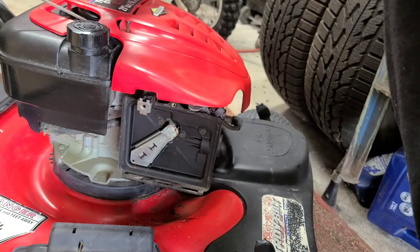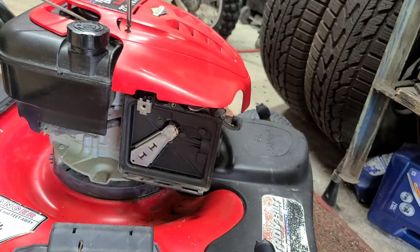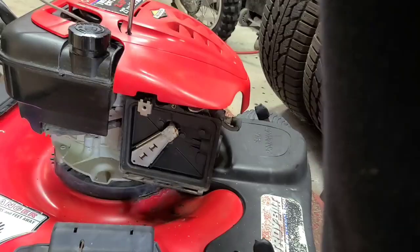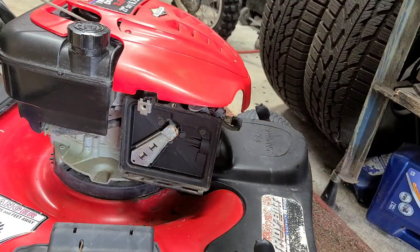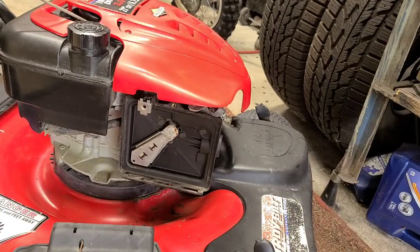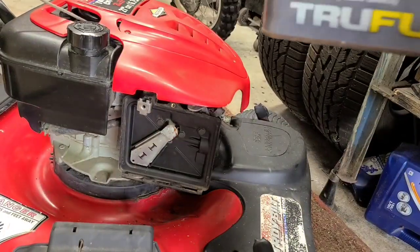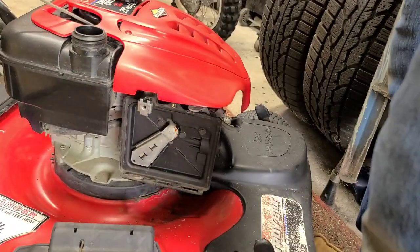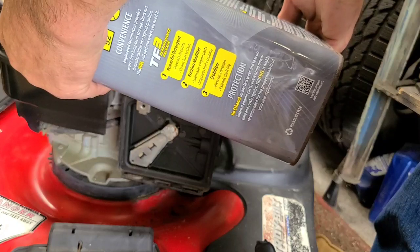This one was pretty clean on the inside — like I said, it looks like it was out of fuel, but they still have moisture and condensation in the bowl. That's what that white layer is — when that small amount of fuel dries up they turn that green color. I hate those screws on top, they always want to strip out. All right, let's get some fuel in this push mower, self-propelled mower, and see what she does. I got the TrueFuel — no ethanol and all. Sometimes I like to use a two-cycle mix with a little oil in it for the spark plug, but not today, I don't have any mixed up.